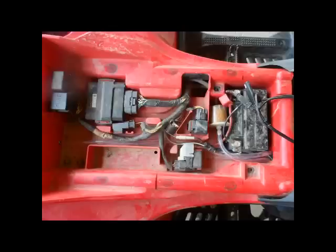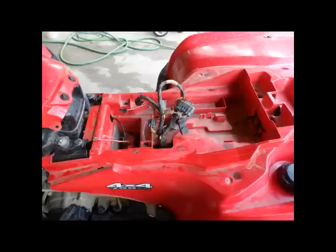This is the first area you need to look at — it's under the seat. The electrical connections need to come off. The fuse box to your left will actually go through the hole there whenever you pull your plastic up. These are some of the connectors that you'll need to pull loose — just pull those loose and they'll go through that hole.